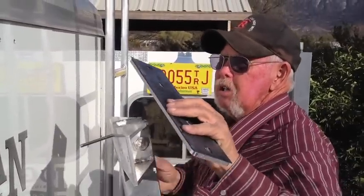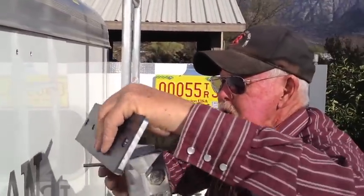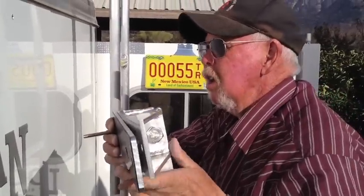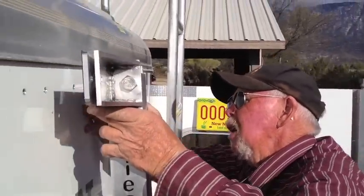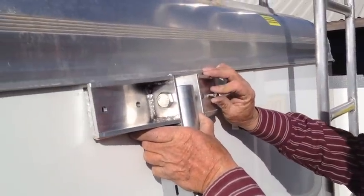On this particular application we want the rubber next to the trailer, glued onto the spacer, which is then fastened onto the Tie Right. Then we lift it in place, put a bolt through, and get it lined up.